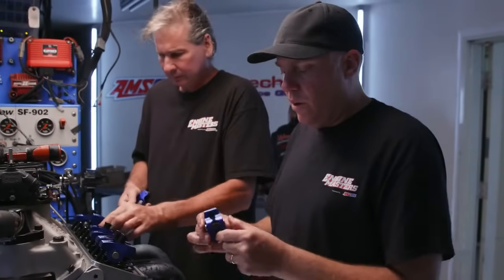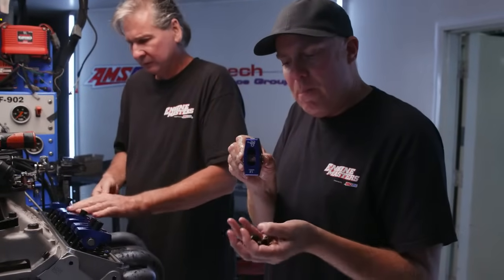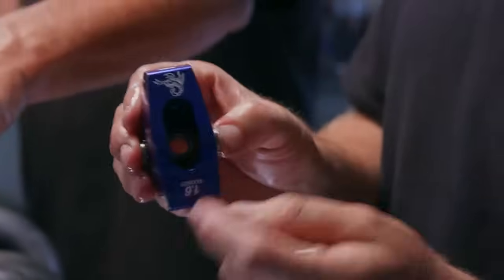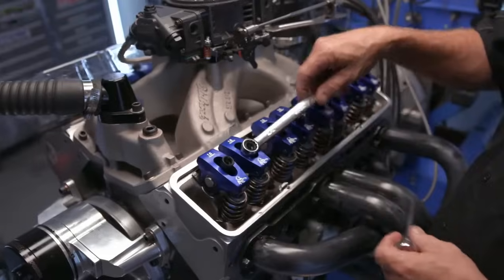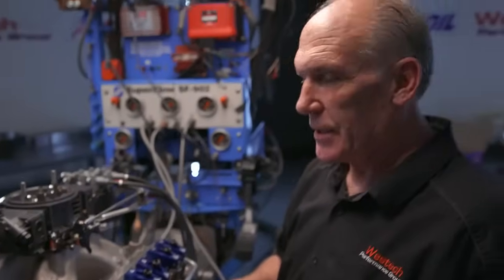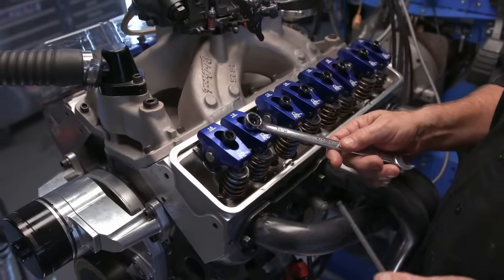One thing you need to make sure of when installing any of these roller rockers is that you get the trunnion the right side up. You can see it's flat on one side, which is where the polylock seats on it. If you flip it over, it's not machined flat and it won't fit right. For lash adjustment, a lot of guys will pre-adjust the valve and try to use the set screw to jam it, and you frequently find the rocker arm comes loose. What I do is bring it down to zero, put a quarter turn preload in it, then tighten the jam screw and tighten them both together. With a solid lifter camshaft it's more tedious because you've got to find the right lash spot, but it's time well spent — otherwise you end up with a bunch of studs coming loose.